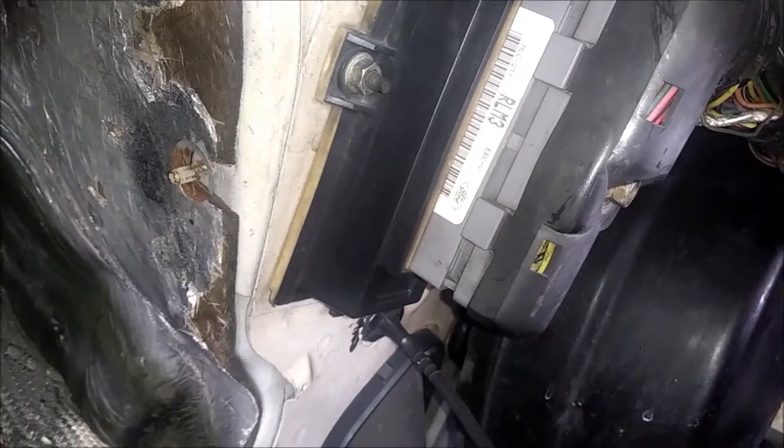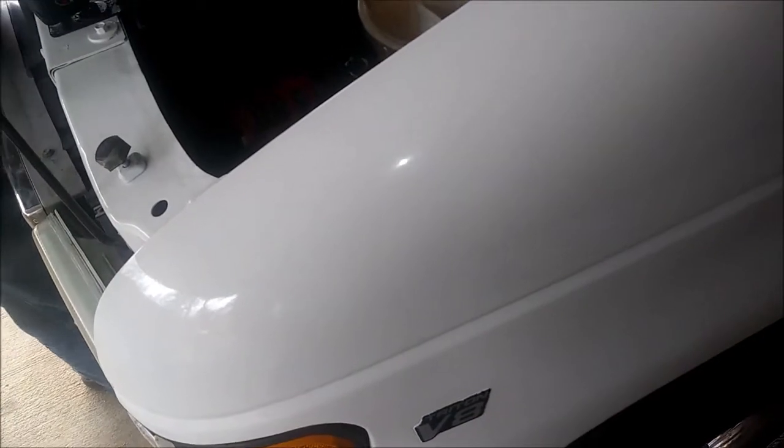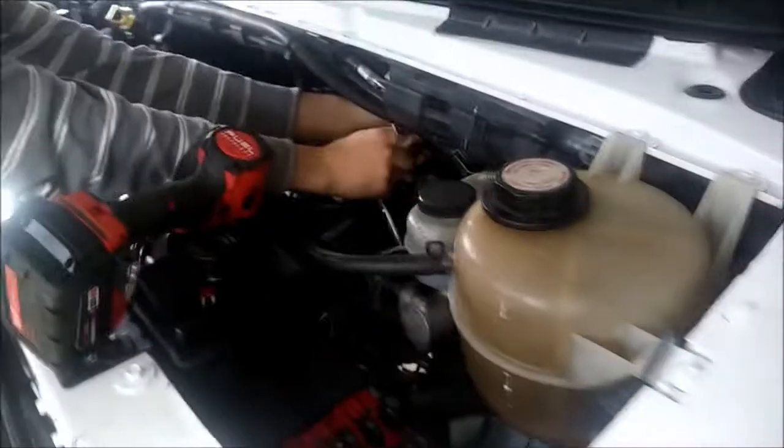The purpose of this is because there's a lot of unanswered questions about reprogramming Ford's computers — that's what this video is centered around. You can see we have a computer in here. The submodel or the other numbers of the computer are underneath that plate. Once we pull that plate off, which is two 10mm bolts — or three — it pulls off the wiring harness, and then the other two, one on each side, let the computer slide out forward.